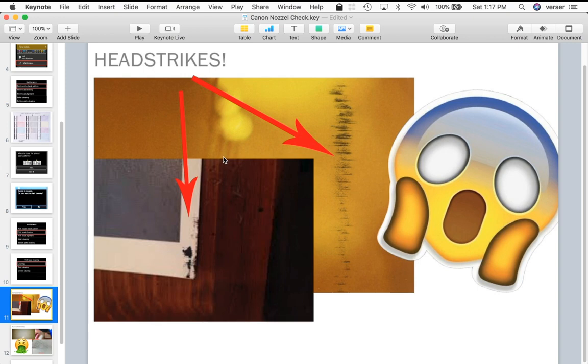There's another problem that comes from doing double-sided printing that we're going to look at in just a second. But at any rate, the solution for this is to increase the gap between the print head and the roller, and to also make sure that your media is completely flat, and then also, if you are doing double-sided printing, that you have let the first side dry overnight.